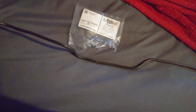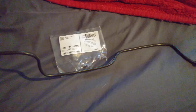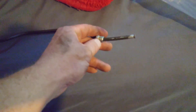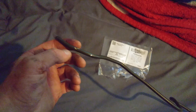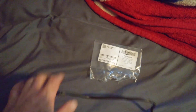This here is a pre-bent line I did a couple days ago. I wasn't really going to buy a set — I was trying to go the cheaper route and just bend my own line. This is actually a six-millimeter line, which is a little bit bigger than what's on the truck. I tried to match it all up. One end was fine as far as the threaded nut goes, but the nut on the other end was rounded off. I bought new ones, put them on this line, and realized the nuts weren't the same size on both ends. I was going to cut and fit from the original line, but the threaded nut was too small for this line, so I said screw it and decided to just buy new lines.